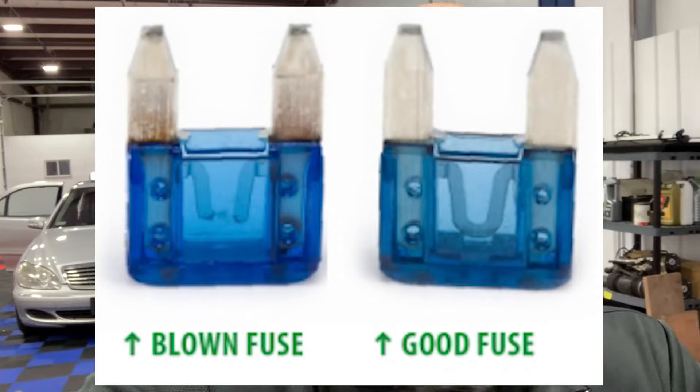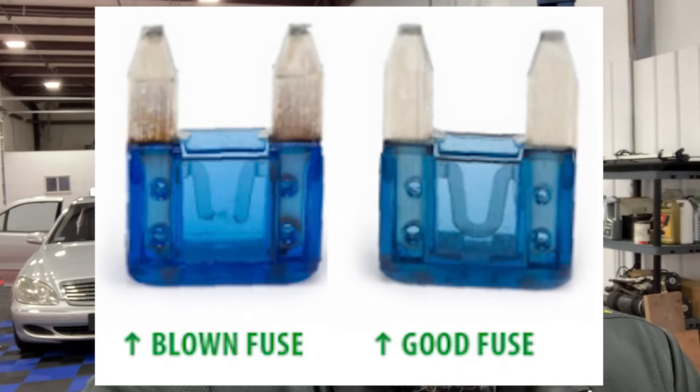If the fuse is blown or if the fuse is good, pull it out, put a new one in, and see if the system functions. If it functions, what happens is you erased all the fault codes and now the system's gonna work again. If the fuse blew even one time, the PSE pump is gonna be bad — I have yet to see one where it blew the fuse, you put the fuse back in, and it works fine forever. If the locks and everything work but you have a problem with the soft close, pull the fuse to reset it and put it back in. If the system works again, you have a leak in that system. All the yellow lines lead to everything — whether it be the seats, the door close feature, or the door locks.